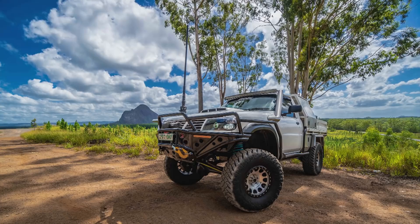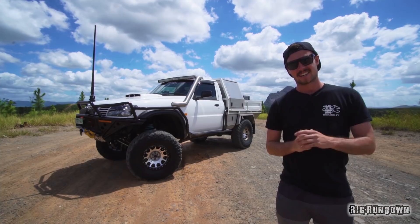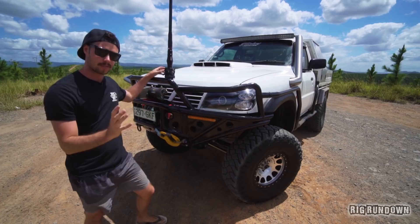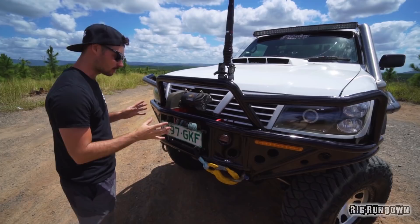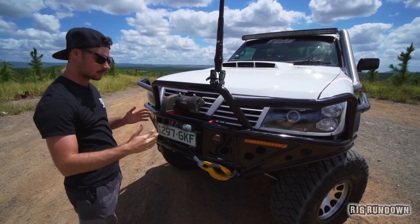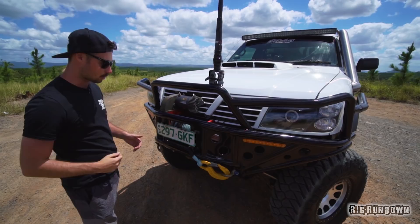It's no stranger that I know and love patrols, and I know a good one when I see it. Without further ado, let's get straight into this one, starting with the front. Jared's actually custom made everything on this, starting with the bull bar — a full tube custom made bull bar — to house this massive Warn winch. It's got 76mm wider track on it as well, and it also has air spool. With the air spool, you can basically sit in the car when your mate runs the rope out, just hit the button, it locks back into the clutch, and then you can run straight back in — so you don't have to get your mate to come back and hook it in. Awesome bit of kit.